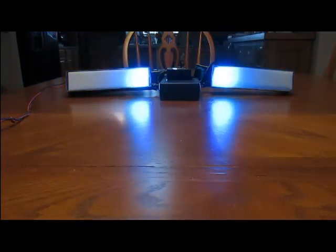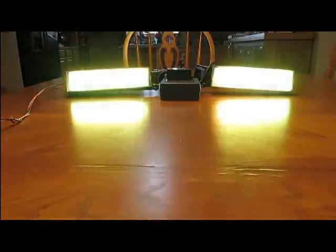So now it's on scan 2. It'll run this one 5 times and then so on and so on. The strobes it'll do a little more than 5 times. If I want to go back to my normal scanner control mode, I hold down button A, 3 seconds, get my feedback, and now I could actually start changing scans again. When I'm in combo scan mode, if I just press any button, it won't do anything. You'll hear a click, but the scans will just keep on running.